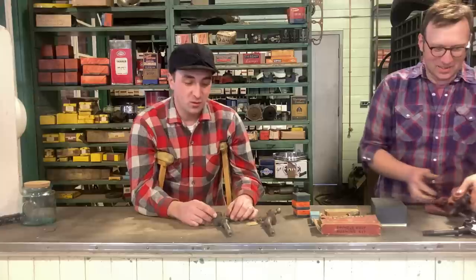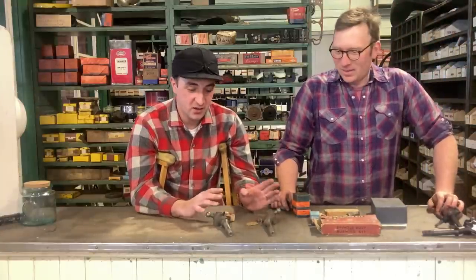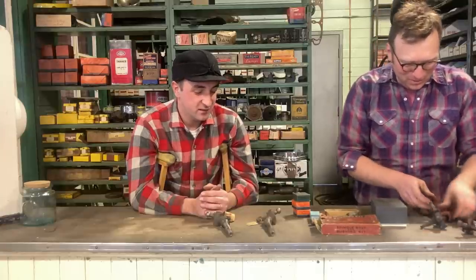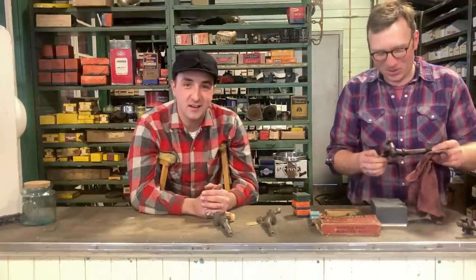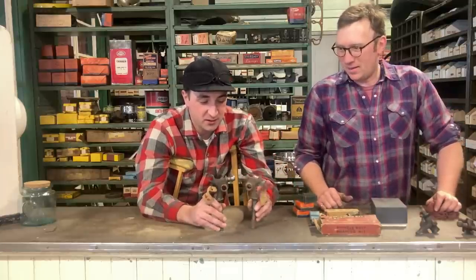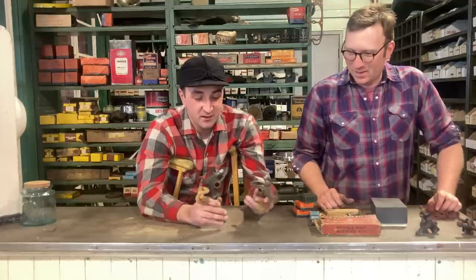There you go. Well, before we carry on putting this thing together, we thought it'd be neat to show some of the parts we got for this particular car, which is Jim's. The perch pin. As you can see, the old ones are well used. Paper thin on the edge. And the ball's gone. And this one, for whatever reason, the ball has been torched off, which I plan to run shocks, so yeah. I need the ball. So our friend Terry there had some stuff, so he sold us these NOS ones, which I thought we'd show before we get them cleaned up and put in the car. They have the little paper tags. This one was $1. And yeah, they're original Ford ones.